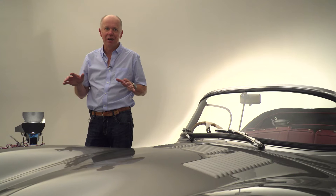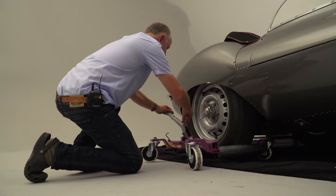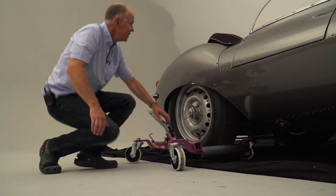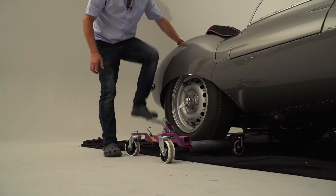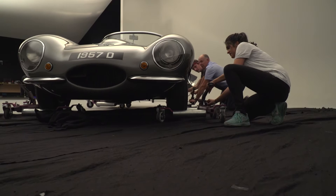Like many race-derived cars, its panels are made of lightweight thin aluminium, so it's always best to stick it on skates to move it, or push the tires and not touch the body panels at all. These skates are invaluable if you have to move around a valuable car like this fabulous Jaguar XKSS. You just fit them around the tire and then jack them up. You can then push on the skate — you don't have to touch the car at all.